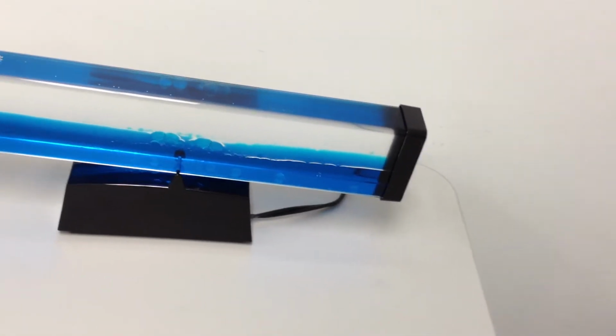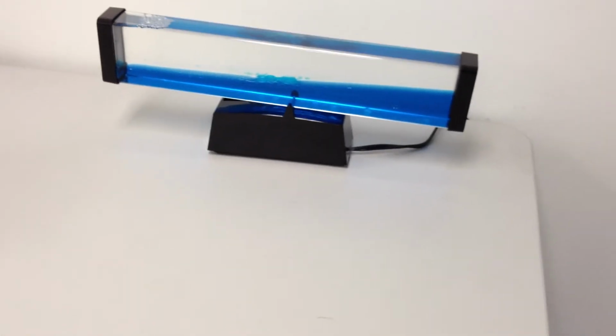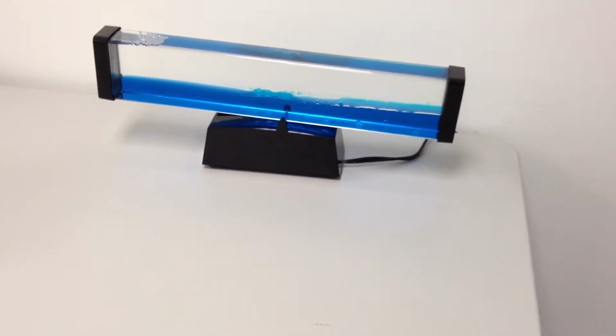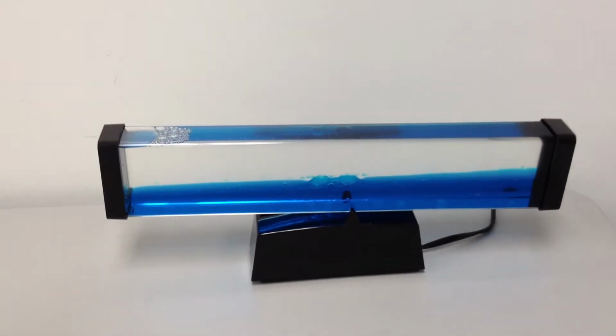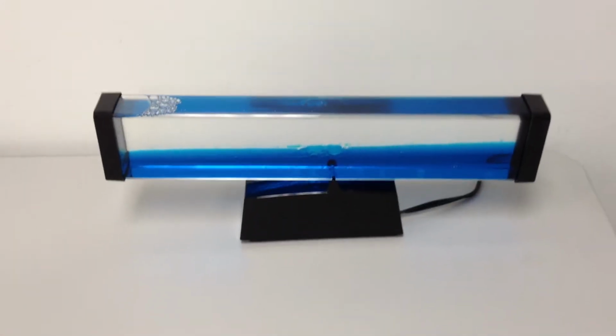So there's a couple ways of rectifying that. A lot of people try to add their own fluids to the machine, and what you end up doing is damaging the actual fluids that are in there, and the machine becomes very unattractive. The fluids will get super cloudy, that kind of thing. You can't just add baby oil to your machine and think it's going to be okay, because that's not all that's in there. I will be offering a service to refill old lava vessels that have this type of plug on them, the removable rubber plug, not the ones that are on some of the Caribbeans that have an acrylic plug cemented into the bottom of the vessel. I'm not going to touch those because they can be very dangerous to work on as far as breaking the actual vessel or removing that plug.